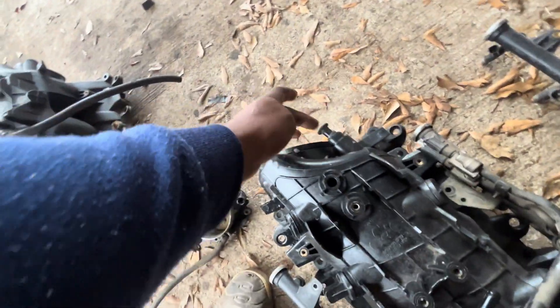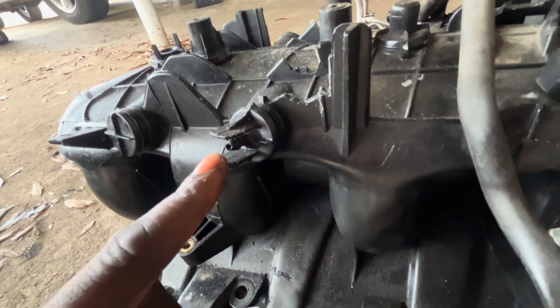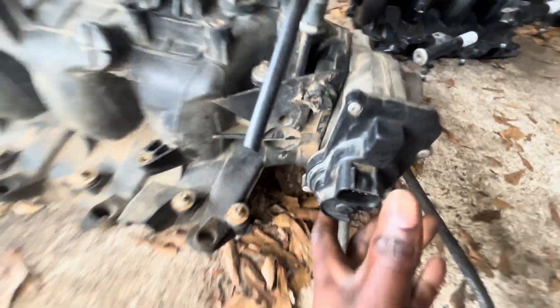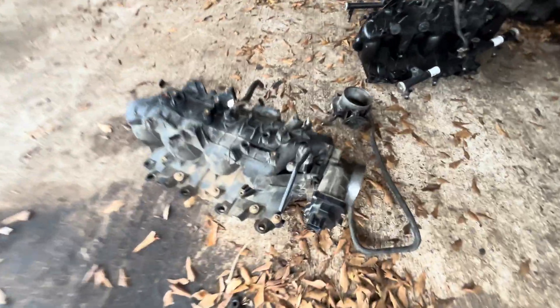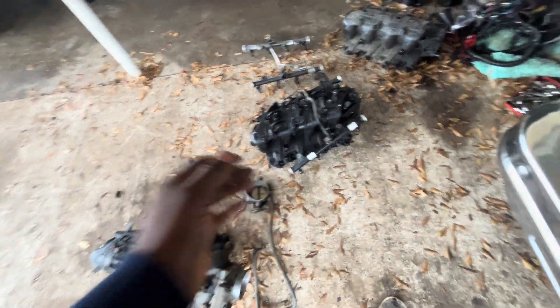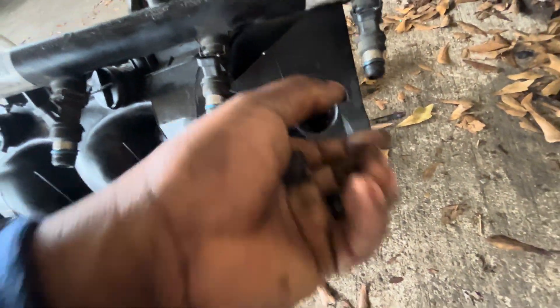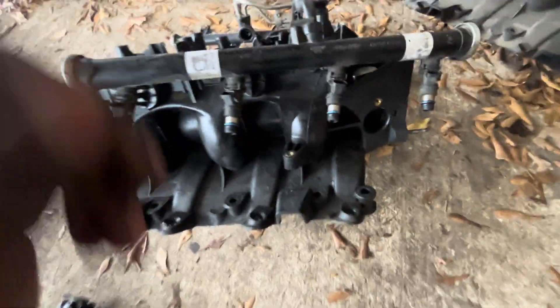Going through the 5.3 — you've still got your brake booster port and your MAP sensor port here. This is what I actually tore off — you can see the little hole right in the middle. This is the vacuum hose I had going to my transmission. The difference is when you see this block-off right here — nothing goes there, you don't need anything on your EGR port.